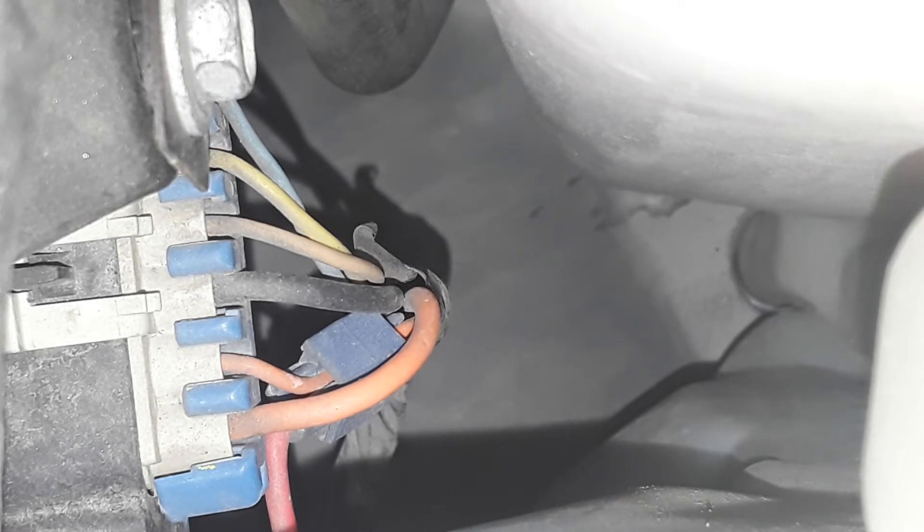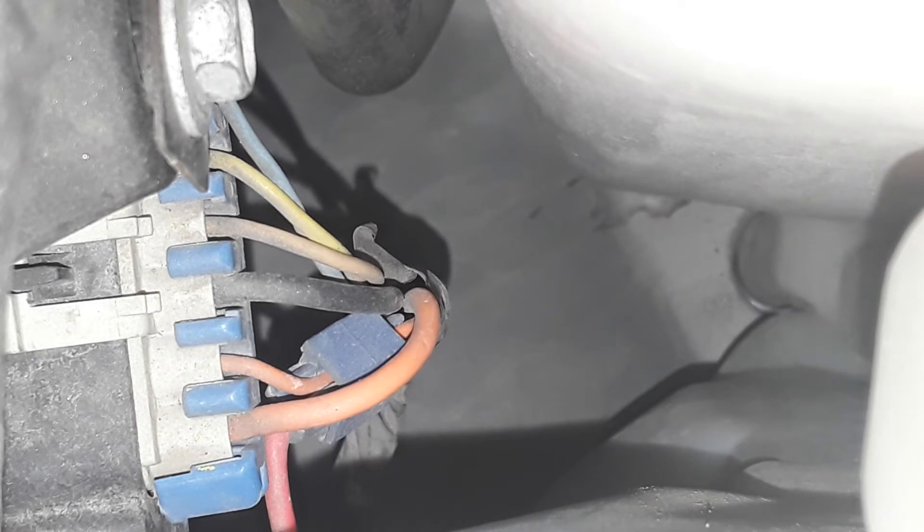Those resistor banks are a joke. They're expensive, they're hard to change — I hate doing it. It takes a little 5.5-millimeter socket and it's a stand-on-your-head situation, unless you want to take the whole front of the car apart. These vans are packed really tight. The Trailblazers aren't so bad — there's a lot more room under the hood. But as I said, I ain't buying any more cards for this thing.